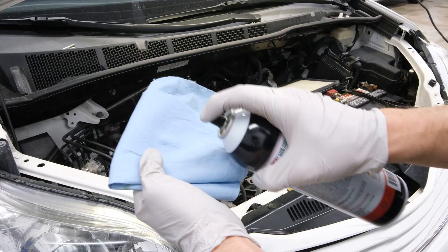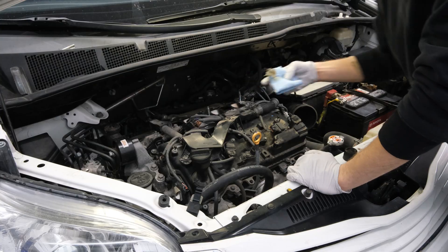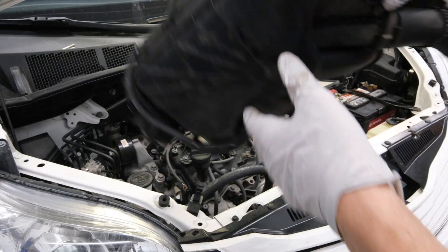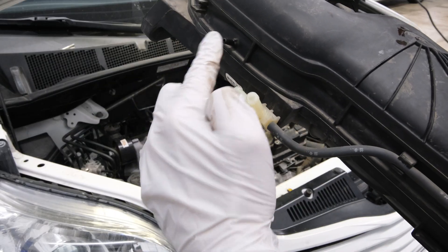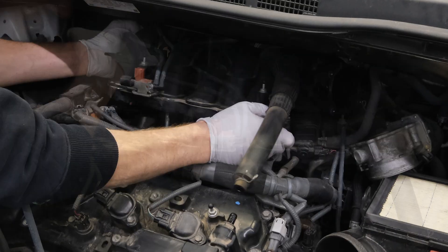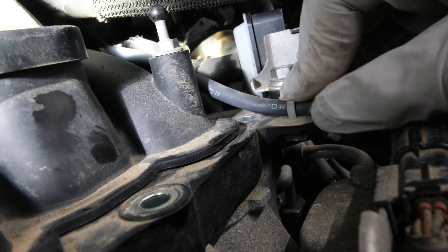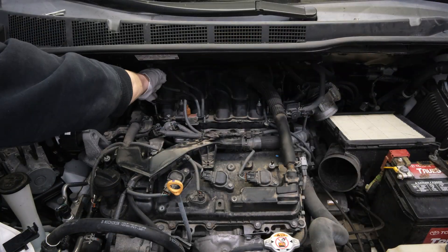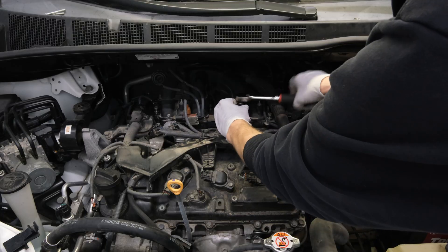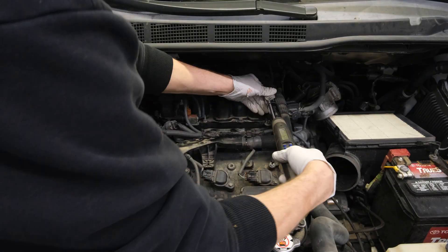Now we can remove our rags and clean the top of that intake manifold to make sure it's a nice clean mating surface so when we reinstall the plenum it's going to be a nice tight seal. Reinstalling the plenum, make sure we're always paying attention to all the things we took off — these electrical connections and the vacuum hoses in the back that need to be reinstalled, because if we don't reinstall them we're going to have issues. Position the plenum in place, set it down onto the intake manifold, and put the connections and vacuum hoses back in their original spots. All the fasteners can now be reinstalled in the intake plenum to the manifold, hand-tightened first. Then we can take out the torque wrench and apply the proper torque to each fastener, making sure it's nice and sealed tight.